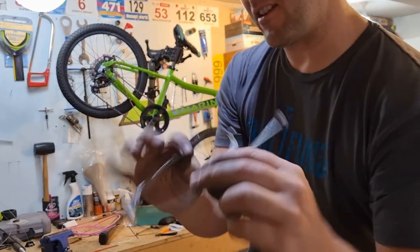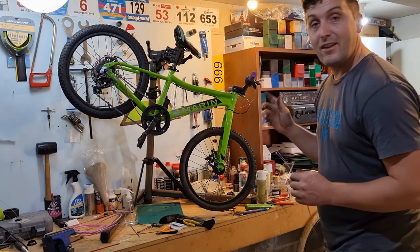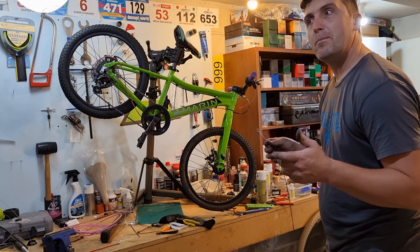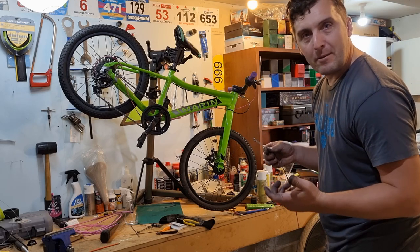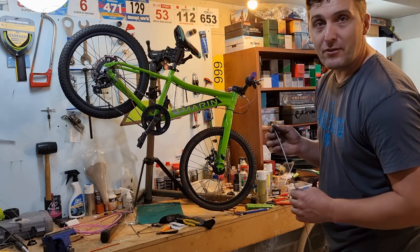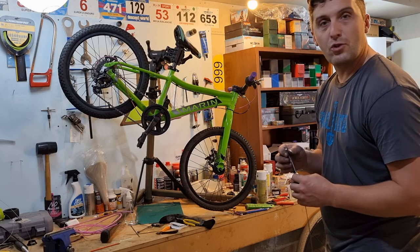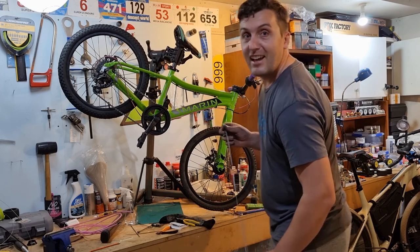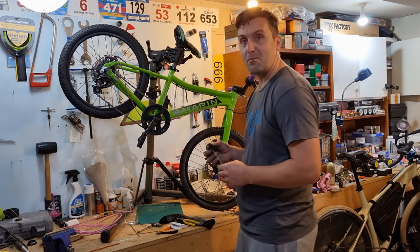It's a pretty good idea. If you're wondering why I'm not upgrading this bike to hydraulic disc brakes, there are two reasons. One, because it's relatively expensive. And two, because I found that my kids have real difficulty not just locking the brakes up - they find it difficult to modulate the brakes to anything other than on and off with hydraulic brakes. Whereas with cable pull disc brakes, because they're a bit harder to pull to make the wheels lock up, they're a little more in control of the braking rather than just grabbing a big handful. So I've decided no more hydraulic brakes until I'm reasonably sure they can cope with the ease of pulling the lever and locking up the wheel.